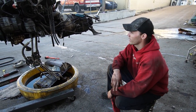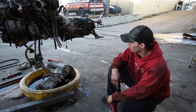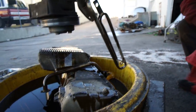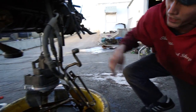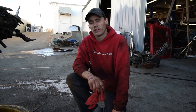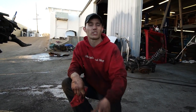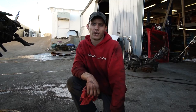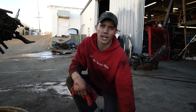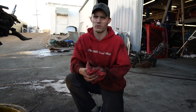We got our S52 and trans hanging here — it's going to be ready for this E30 tonight before we leave. We're going to get the rest of the parts in the morning. What we just did is we swapped the E36 pan, which is rear sump with a rear sump pickup, to a front sump E34 pan with a front sump pickup, which you have to have for any 24-valve E30 swap. Any motor you put in an E30 has to be front sump, or you better be really good at fabrication. This is the trick to doing 24-valve swaps in an E30: using E34 M50 oil pans.